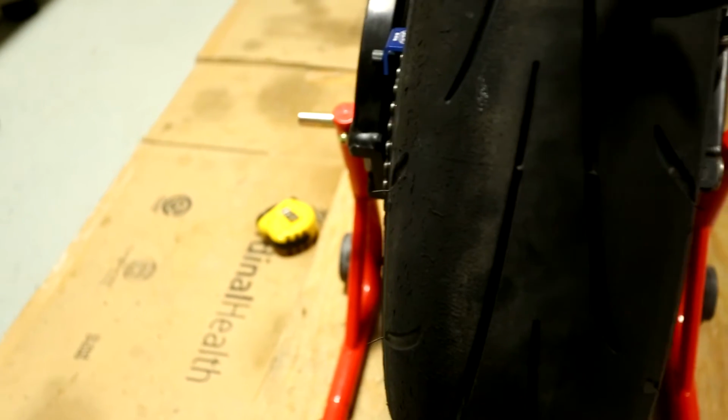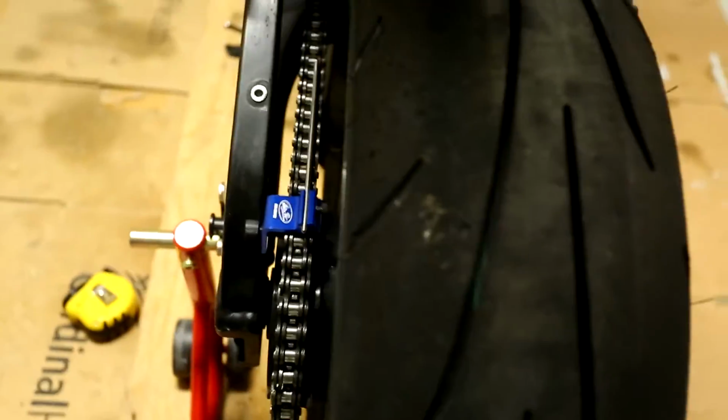And I think one way you can easily tell is if you look at your tire after you rode it, you see this center line, the center white part. That's where it's going to get ridden when you're riding straight up. I noticed that it was a lot more on the left than it was on the right, and I was just riding on the street just to work. So it should have been just about even, but there's a lot more to the left. So I checked it, and now it's just with using the hash marks.